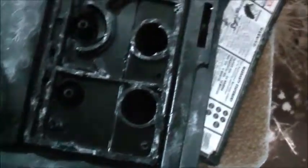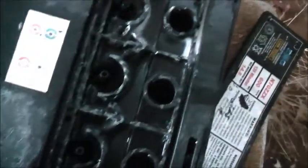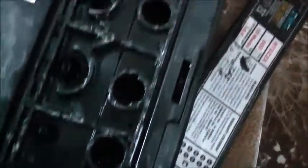I've filled it and had it dry out for about 3 days after rinsing it 3 times. I put in fresh rainwater, which I distilled — rainwater would do. It doesn't seem very effective actually. And mix it with a roughly a tablespoon of bicarb soda per cell. You've got to be quick as it will just bubble up and fizz like a volcano. Obviously the bicarb soda is going to neutralize all the acid, which is what you want. Obviously the battery is not going to work after that because no acid means no reaction, there's no energy anymore.